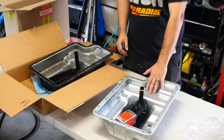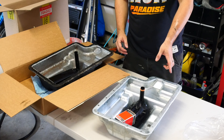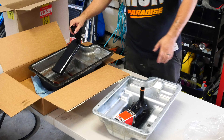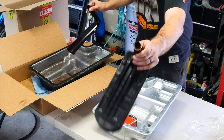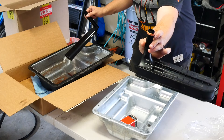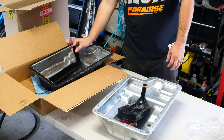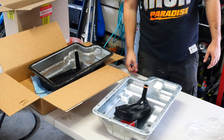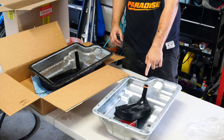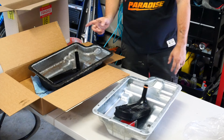I have this Lube Locker gasket. We're going to clean out the pan first, then put the new filter in with the new pan — and it's going to be great. One important thing to note: when you take out the old transmission filter, there's going to be a little orange gasket on the tip of the filter still stuck in the filter housing of the valve body. Make sure you grab a pick and pull that out. If you don't, the new filter is not going to seat, you'll have no filtration, and you're going to burn up your trans. So let's get the new filter installed, get the pan back on, and then do the toilet paper roll up front.